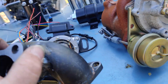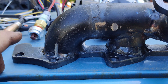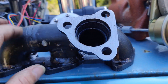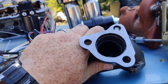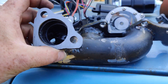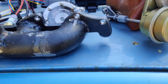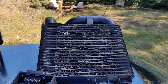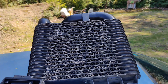I made just a standard log-style manifold — the cheapest way you can build a turbo manifold. I did the same thing for this flange that I did for the intake, just copied the gasket, except this one I cut with the CNC plasma cutter to make the flanges, then welded everything up and faced it all off with a fly cutter. I've already checked the mounting before I took the engine out and the turbo sits where I want it — it actually sits like this on the head, so the turbo's going to be top front. I've got some intercooler piping — a cheap eBay kit, all two-inch, because this is a tiny motor. And I've got an old Toyota MR2 intercooler out of like a '92 — a friend of mine left it in my garage years ago and I've finally found a use for it.